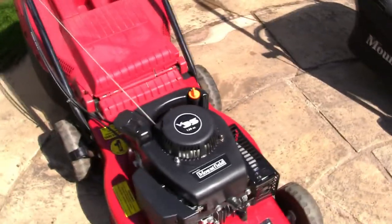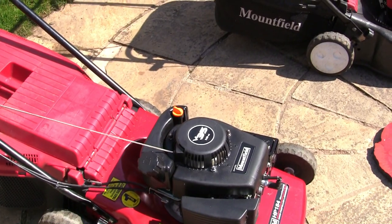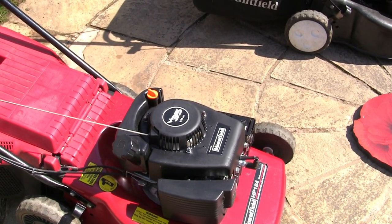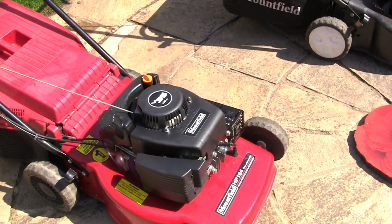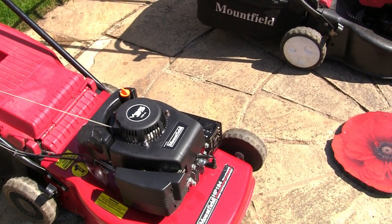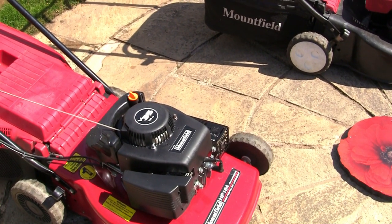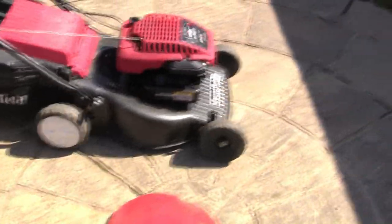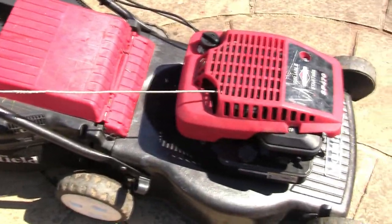But most of the time the problem with spark and ignition is what I've just shown you. It's the kill switch wire that's broken, or it's the kill switch not releasing correctly. It's very rarely the actual ignition coil. The only time it may be the coil is if somebody's already had a mess about with this and they haven't set it correctly. And again, below all the affiliate links in the description, I will leave a link showing you how to set the ignition coil. But I would strongly advise you that it won't be that that's causing the problem of no spark. It's much more likely to be the kill switch wire, or the cable not releasing the kill switch correctly.